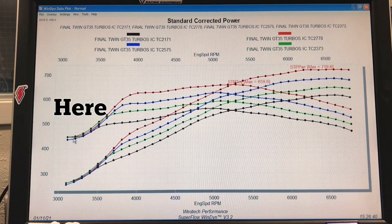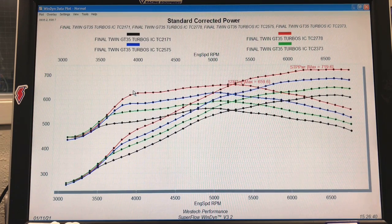If you take a look down here from 3,000 to 3,500 RPM, you can see this thing is basically coming up and getting responsive on the turbo. It does not have full boost at 3,200 RPM — that does not happen until after 4,000 RPM. So now we can compare this to what happened after we extended the exhaust length by 12 feet, basically remote mounting the turbo toward the back of the vehicle.